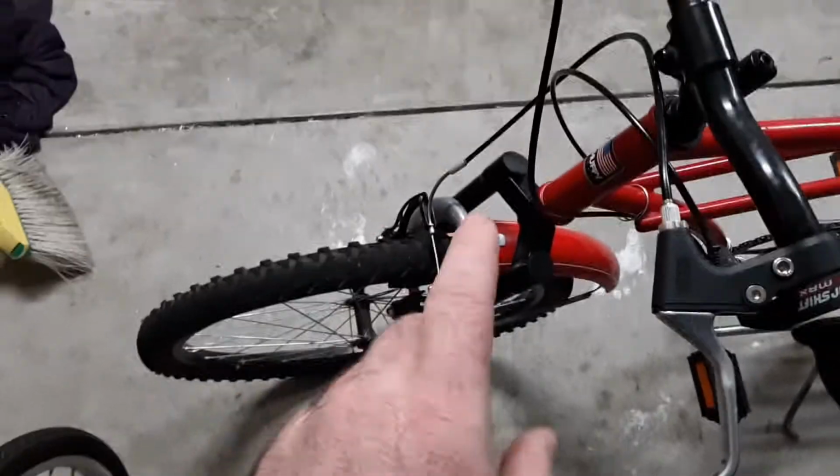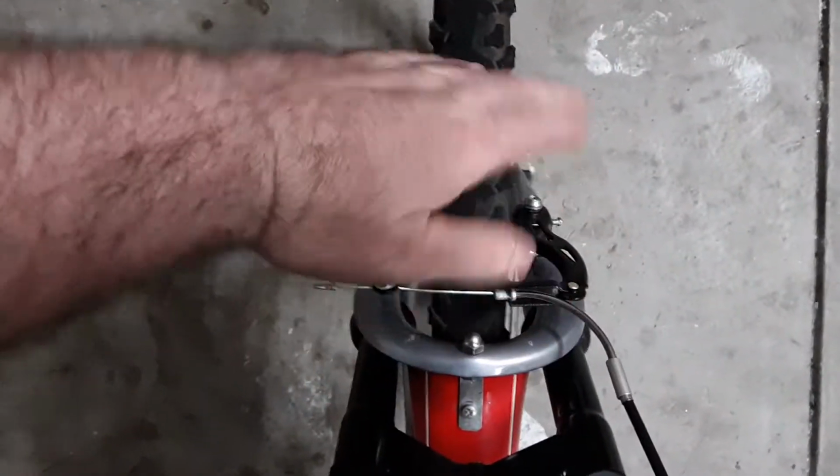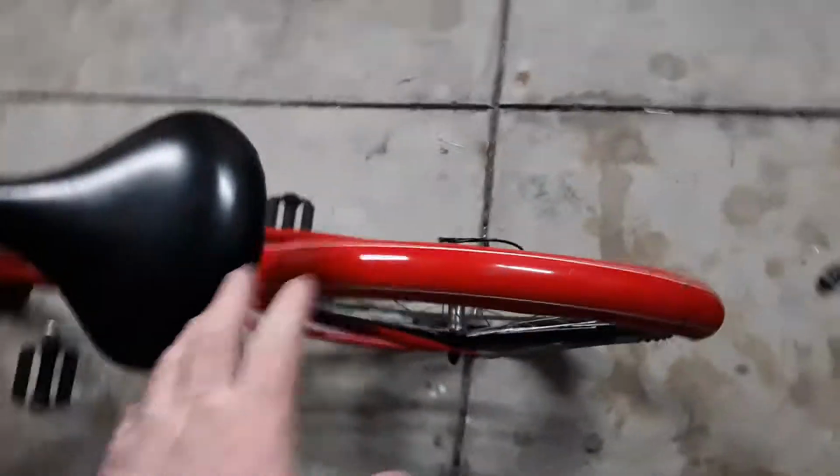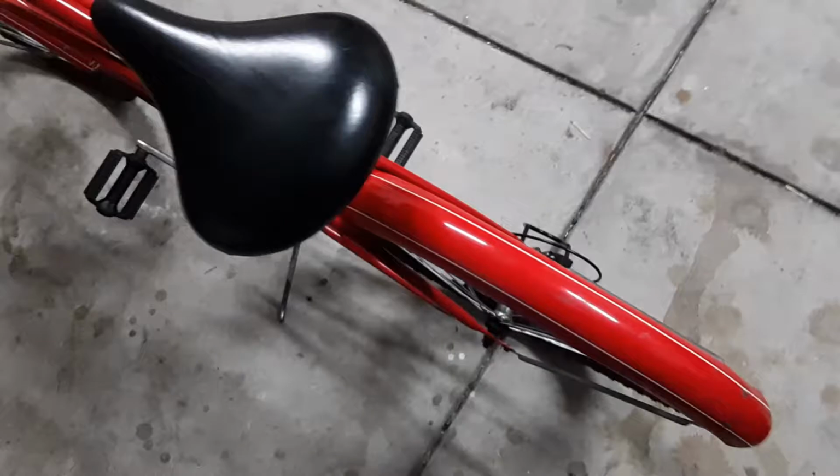Anyways, the front has a cantilever brake, which is on the mountain bike suspension. So I had to put a little plate on there and cut the fork from here out, which is fine. I can bottom out the suspension, and it won't hit. You've got a little protection so you don't get crap on you. And the same back here, otherwise you're gonna have it all up your back. Anyway, so that's all done. Everything works. Rides pretty good.